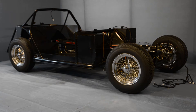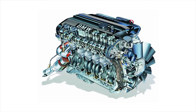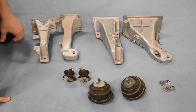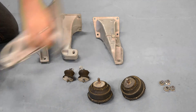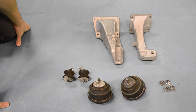Now that our electrical system has been installed in our chassis, we're ready to install our engine and gearbox. The Mirage GT chassis supports both the BMW M52 or M54 engines and a manual 5 or 6 speed gearbox. If you're installing an M52 engine you will not need to change any of the engine support brackets. If you're installing an M54 engine you will need to change the larger right engine support bracket for the smaller M52 version, which will be included in the kit.